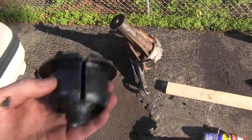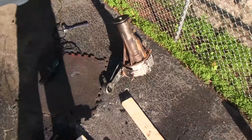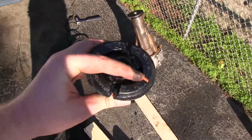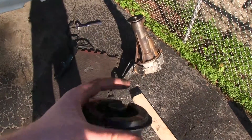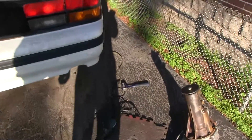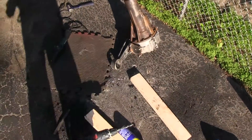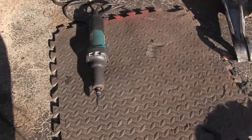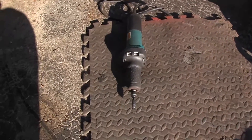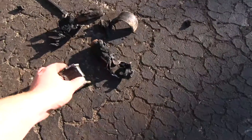So it's in there really tight, and if you haven't changed this in 30 years, these things are super hard to get out. You've got to drill out all the rubber and then bend the lip of the metal piece forwards and upwards using a hammer. You can see the hammer and chisel in the corner there. And if it still won't come out, you'll need a Dremel — I used a Makita electric Dremel — and start grinding it away until it finally comes apart in two pieces.